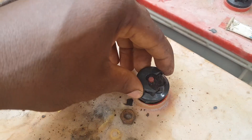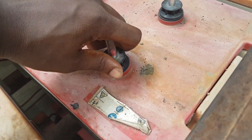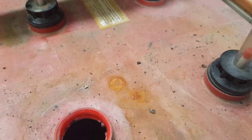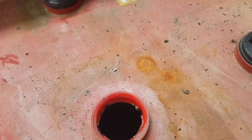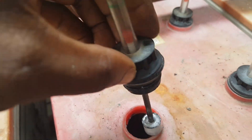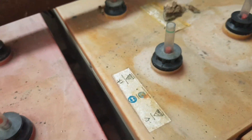One of the things I noticed is that there's a lack of maintenance on this — you can barely see water in this battery, there's nothing inside. You'll also notice the case for the battery has faded out, there's a whole lot of rust. And when you bring out the battery caps, the caps are down — that shows there's no charge on the battery at all, it's so bad.